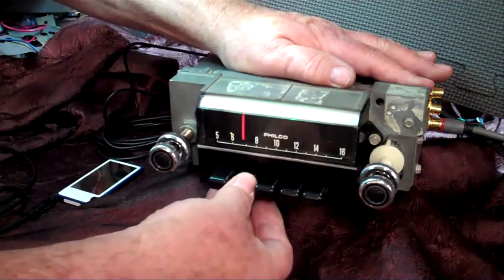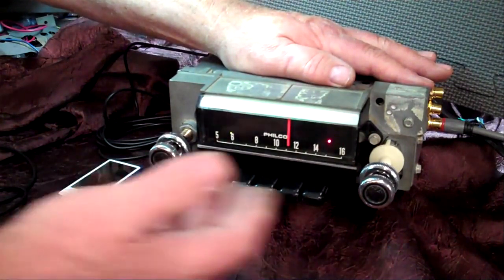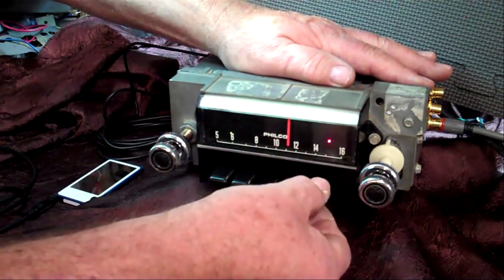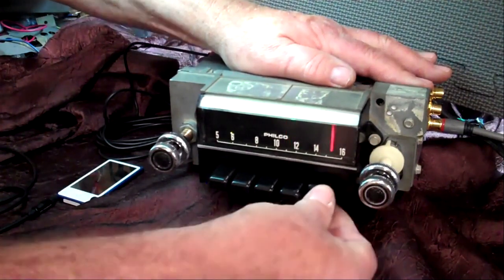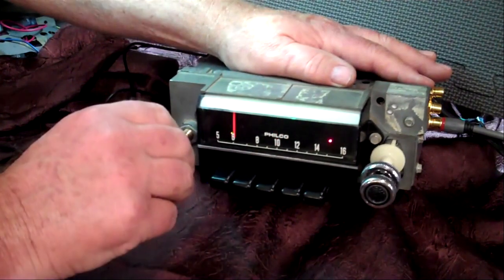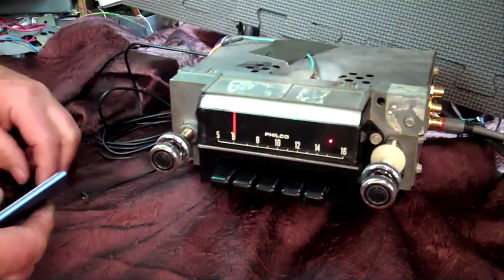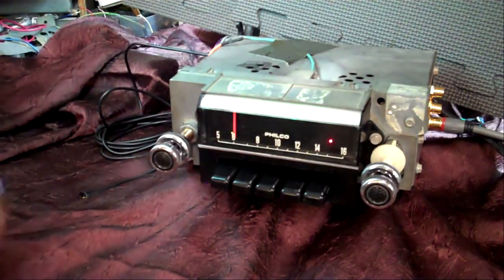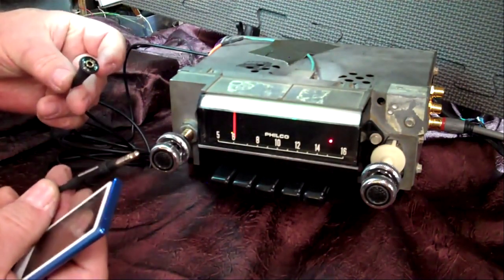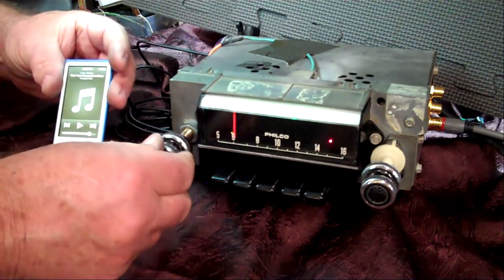We keep the original tuners so all your push buttons still work and presets. People ask me how do I know if I'm on FM - well you don't really want to change the face of it because then you might as well buy an aftermarket radio. So what you do is find your favorite FM stations, pull it out, push it in, and you can go back to them. A lot of people don't listen to AM anymore. If you want to go to AM radio, just turn it off and right back on. It also has automatic auxiliary in - multiple devices, you can plug satellite radio into a CD player. If you want to hide one in the trunk, pipe it in; as soon as you turn it on it switches. You'll get a two-piece harness - one you can hide and a male-to-male - and all you do is plug your device in and it will switch over as soon as you turn it on.